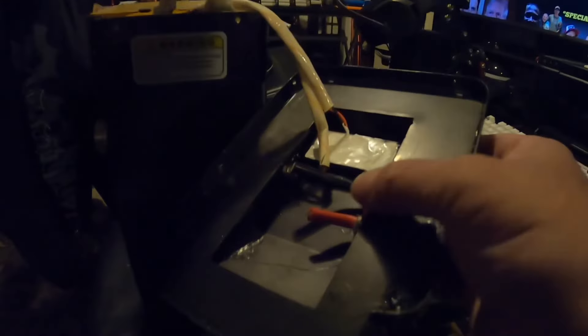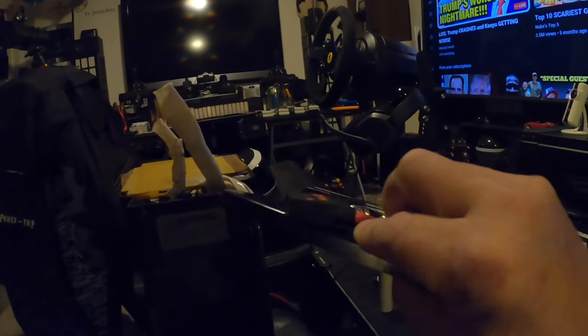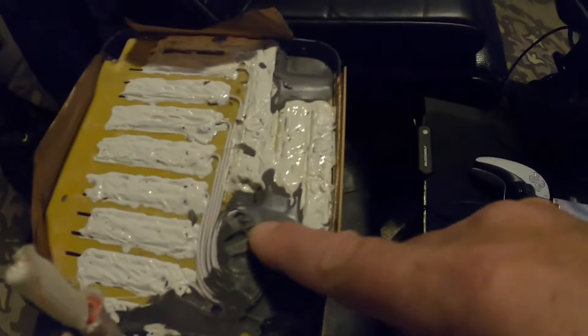The top was off already. When I took this top off — it didn't have the screws — I cut the power leads because I didn't want that to short out while I was moving it around on that metal surface. So I just cut the leads. This person had started to work on this pack, so this was open like that. As you can see, the inside of this pack is potted — it has that gray compound in there.